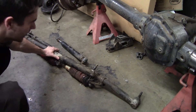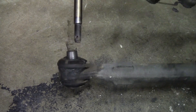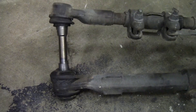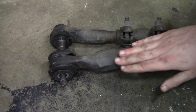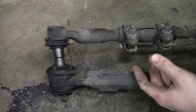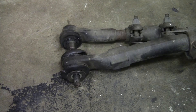The other side though is a little bit funky. As you can see this has got a double taper and the tie rod is actually a sleeve — you can see that's just a sleeve part right there. And then your drag tie rod end has a real long pin that runs through it and through the knuckle. What I'll probably do, at least for the short term, is set up the steering to where I'm reusing the stock tie rod and reusing the stock drag link end. I'll just take it off here, build a new drag link so that I can adapt it to my pitman arm for whatever steering box I end up running.